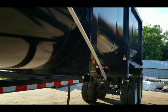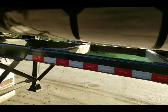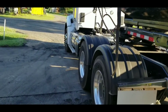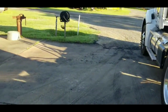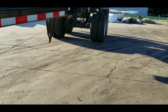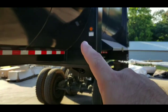This trailer is 83 cubic yards, but it is 2,500 pounds heavier than the Clement Monstar. With this truck and day cab trailer configuration, I'm at 41,000 pounds full of fuel. With the Clement Monstar and the same truck, I'm at 38,500 give or take a few pounds.